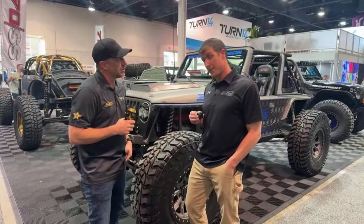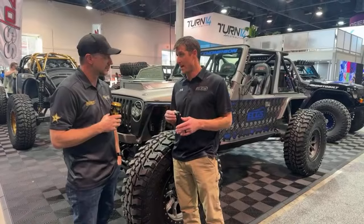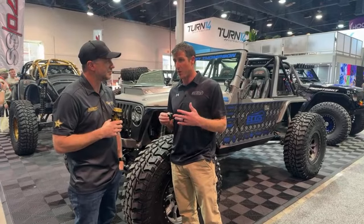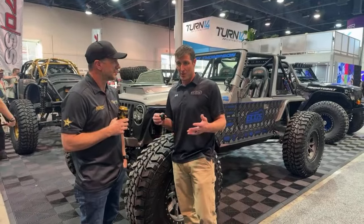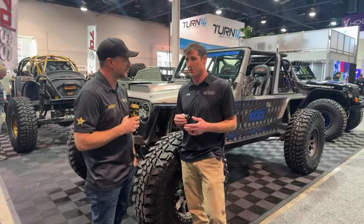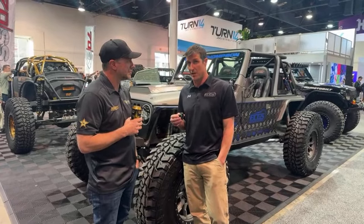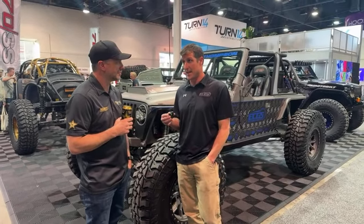Yeah, so the 40 spline rear was like one thing. We did that a long time ago, 8 years ago. About 2 years ago, we developed the Kingpin 540, and it's a big Kingpin C. We don't really use ball joints, which a lot of guys have converted to, and you can make a big enough ball joint and whatever, but the Kingpin's always going to be stronger. Serviceability is, I believe, better. It lasts longer. And at the end of the day, ball joints are a lot easier to assemble, and from a manufacturing cost standpoint, they're a lot less than the Kingpin.